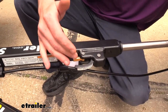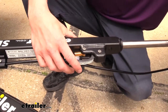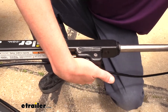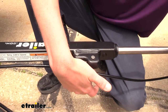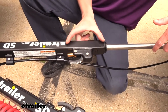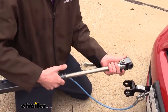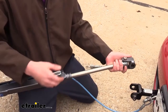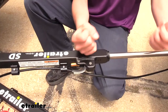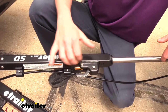The non-binding levers on our eTrailer tow bar — I personally find these to be a little bit easier than the Roadmaster ones. The lever is this small tab here, and it gives you a good place for the palm of your hand to really press in and dig in to get it to release. It just feels smoother, like it releases better than with the Roadmaster. The Roadmasters have a longer lever on top, so you'd think that would be easier, but when you pull that lever up you can feel it pop, but it doesn't release until the lever is kind of halfway on its way back down. It can just be kind of finicky, especially since you have to hold the weight up on that Roadmaster tow bar while doing all this. This is just a little bit easier — it's all one fluid motion, and I just prefer this style.